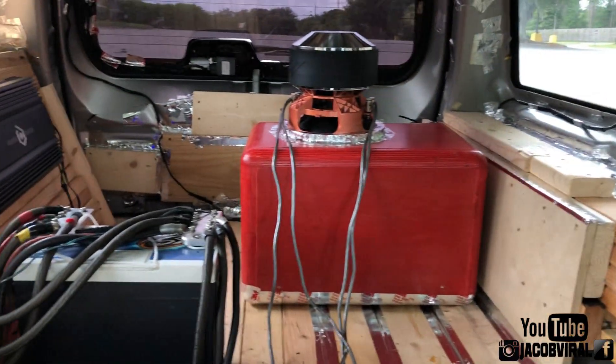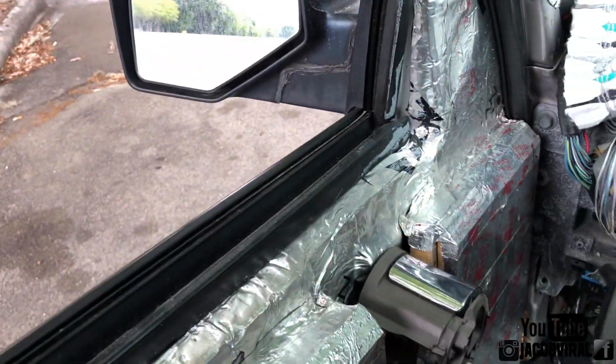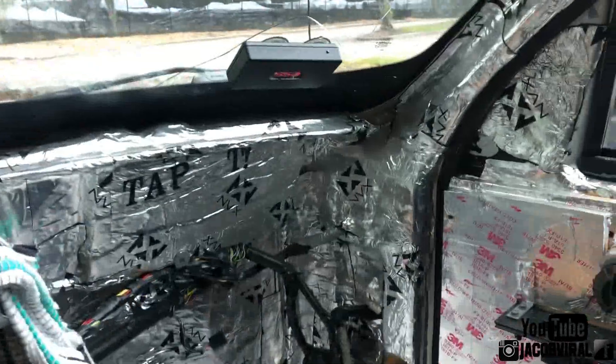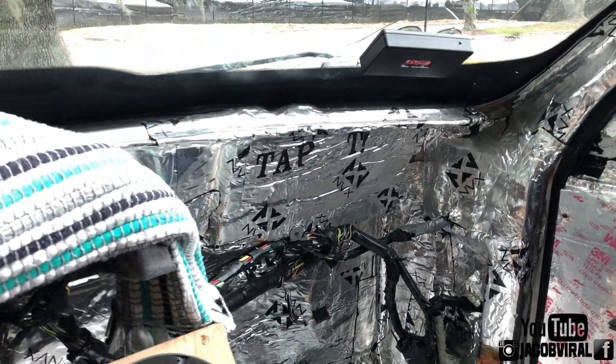So that's not bad. Now we'll do a window down. Keep in mind guys, I went from 160s, 415 wall to just a single 10. My personal goal out of this is if I can get a 145 dB on glass, I'm happy. So a single 10 doing mid 40s on music realistically is all I want. I don't need to have a 150 or 155 or anything. For a single 10, a small cone, mid 40s is a good goal. I want it to be musical so I can still play it down to mid to low 30 Hertz range without issues.